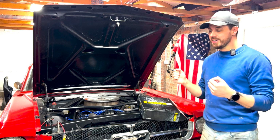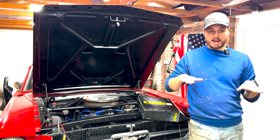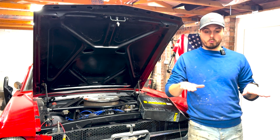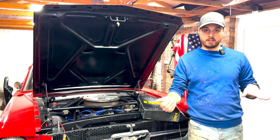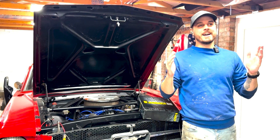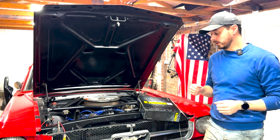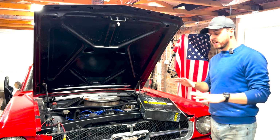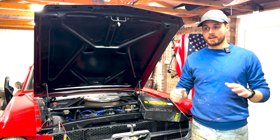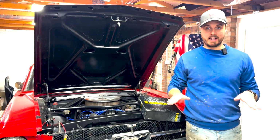I found a few little quirks. So it turns out the driver's seat was mounted kind of on a slant, so the right hand side as you sit in it was kind of one click lower in the set of bolt holes, and that is because the seats don't fit square with the roll cage, so it clashes on the top of the roll cage. So I've made some adjustments. I've put the seats in lower. I've taken the foam off the side just to be able to get fitment and things, and it looks like we're about there now with proper fitment and a nice level seat.